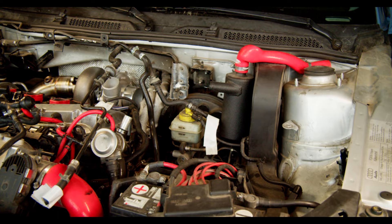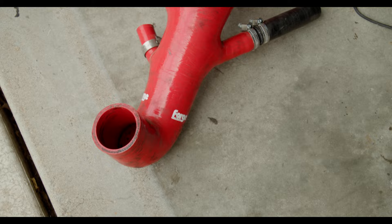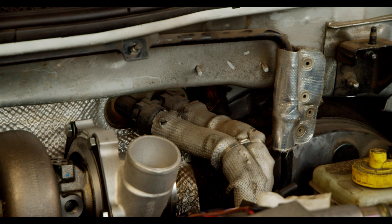Without that, we're not going to get too far. We've got a lot of room to work with, but to narrow down our design, let's use what was originally here for inspiration. We effectively need to create a passage of air from the inlet of the turbo to the MAF, which is attached to our new speed intake. On the stock turbo inlet pipe there are a number of ports for various sensors and systems. Since this car is based on a recirculating MAF setup, we can't just delete them — we're going to have to figure out a way to include them.